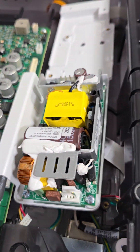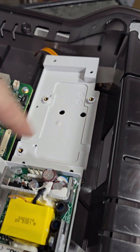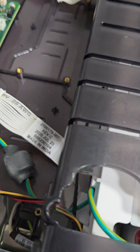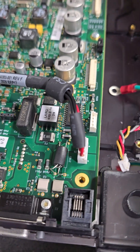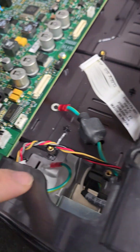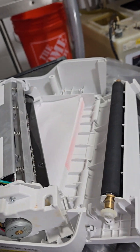Next up you have to pull off your power supply tray. Disconnect the two cables — your input and your output — and then it's six screws: one, two, three, four, and these two right here. This whole thing will lift up; move it out of the way. Next up you've got all these cables — these are also glued down as well as connected. Two ribbon cables, two paper sensor cables here and here, and one molex connector that goes right there. These all have a bit of tacky glue on them, so don't be afraid to put a little force to remove them. Once those are all out, pull this ground cable — it's going to sit right here — and then this whole assembly will pull out once you remove the adhesive from the cable.